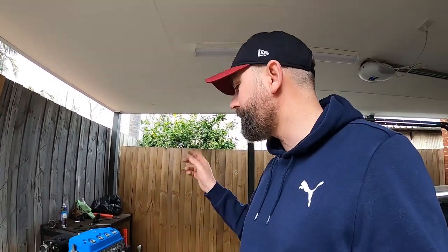YouTube, it's the next day. The engine is put together, which you would have seen in the time lapse. I did run into a few problems, which was the clearancing of the girdle or the main cap part on the bottom. When I turned the engine over, cylinders 2 and 3 were hitting on that, so I've clearanced all 4 of them on both sides just in case heat or anything makes the metal expand. So that's all clearanced, it's all done.